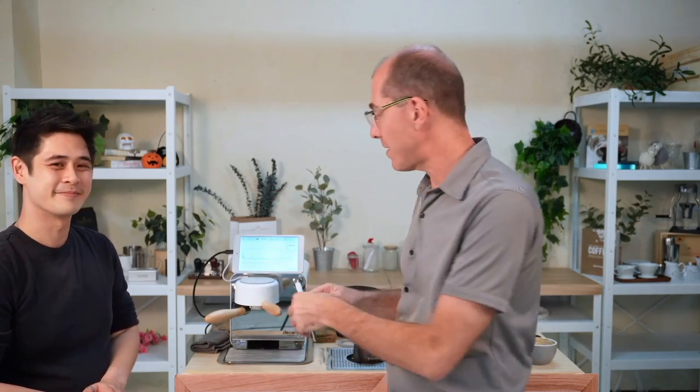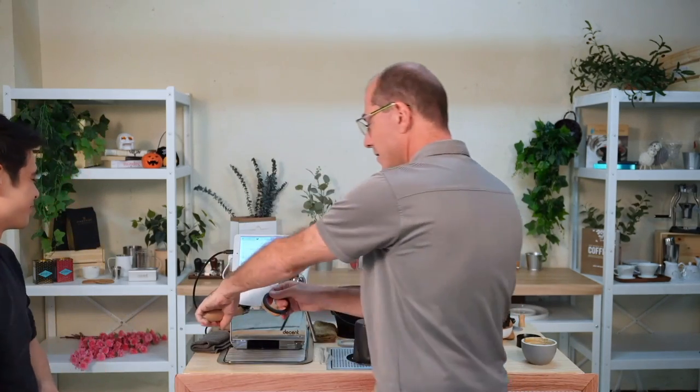When you're finished making your espresso and you lock it in super tight, you compress it and that is going to age it as well. It's important that when you leave your espresso machine at the end of the day — and this is valid for every espresso machine, not just the Decent — that you leave it just loosely locked on, just enough to bite the rubber but not any more.